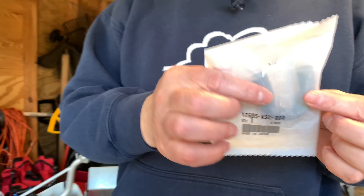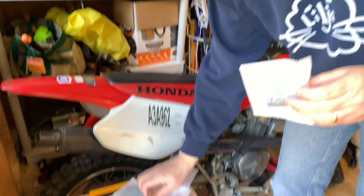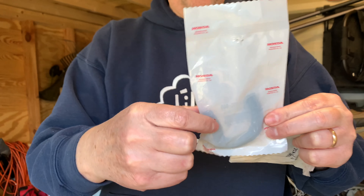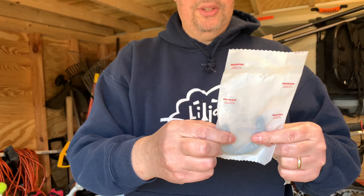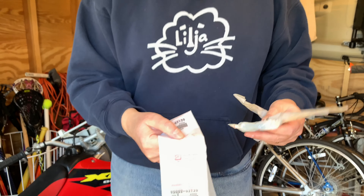We've got almost no fuel flow coming through from the fuel tank down to the carburetor. We'd start the bike up, run it around the yard, and it would stall out — we think part of it is from these fuel lines. So we went ahead and ordered a couple of new fuel lines that have the curve already pre-bent into them, straight from Honda. We got these from Partzilla, and we got the little clips too to clamp them in.